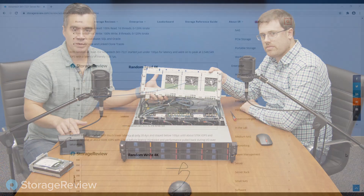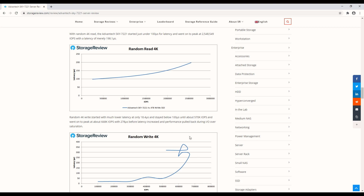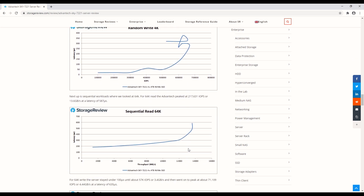Let's take a look at what we saw in performance. We tested four NVMe SSDs — four 4TB drives as the main performance tier — and it does pretty well. We got north of 2.5 million IOPs 4K random read, which is pretty nice. On the random write side, this topped out at around 670,000 IOPs. Latency was actually pretty good: random read topped out at just under 2.2 milliseconds, random write came in at right around 0.4 milliseconds. For bandwidth, you're looking at almost 14 gigabytes a second, and that's just on the four NVMe drives.